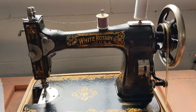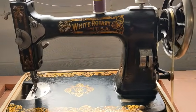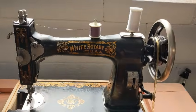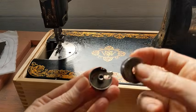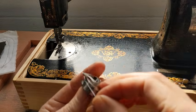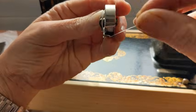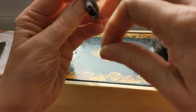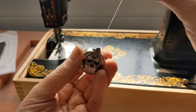And so clunking is just my foot pedal down there. But you can see it's going back and forth and threading up the bobbin pretty well. So pleased with that. And just a reminder how to thread it into the case. So I'm putting my bobbin into the case over here through that little hook. Looking at it from the front might be easier, maybe this way. I need to pull this thread across and all the way down so it goes underneath this little hook on the side there, and then it pulls up through that little nose, okay, like that.